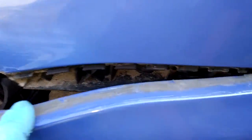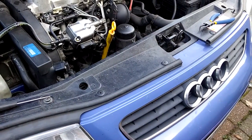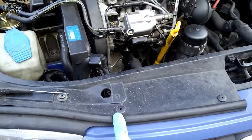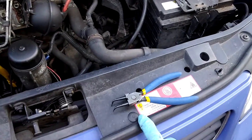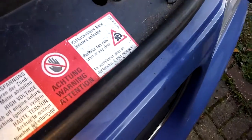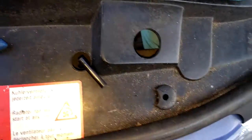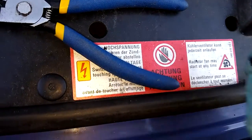To take the bumper off — you've probably taken out your wheel liner; I haven't got mine on the car but the bumper just pulls out. There are then two screws underneath the bumper — this might be a weird view but it's just to show you where they are underneath the skirt. Undo these two Phillips head screws and we've then got four pop-rivet type things on top. You need to get under them and lift them — you can get a screwdriver blade in between, pop them up, and then pull them out from on top. I've had mine off a couple of times when I replaced the engine; they might ideally do with replacing but they still function, so we're going to keep using them.